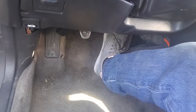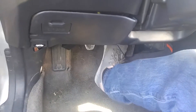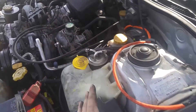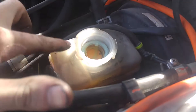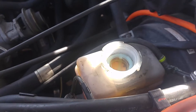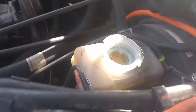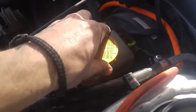Now you're going to want to pump your brakes a little bit. This is going to tighten up those calipers. Just squeeze it, just barely — go kind of slow. It's going to get really hard as long as you have power brakes. Just do it until it's got a little resistance. The reason we loosened the cap on the reservoir is so it didn't hold pressure — so it didn't basically explode. As you can tell, it's wet around the edges. When we pushed those pistons on the calipers back in, it overflowed. That's why we popped the cap so it wouldn't just explode out. You're going to want to wipe this up — brake fluid is really harsh on stuff like rubber hoses and paint and all that. Then just put the cap back on. Now just to be sure that you pumped it enough, make sure your calipers are tight. Start the car and that will give you power brakes, and then you can pump it even more and make sure it's all hard and good.